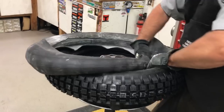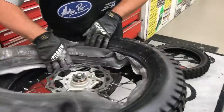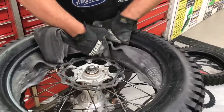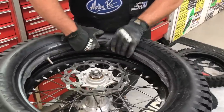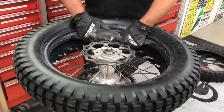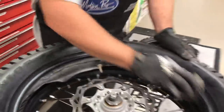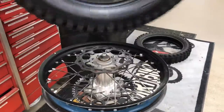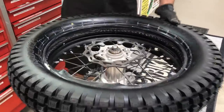At this point I'm going to just lift the tire and feed it in just like that. We are all the way in and I've got just the right amount of air in there. Now we're going to put tire paste on the tire — you want to have a good tire paste. Don't use WD-40 or anything like that because it stays too wet and can cause the tire to fall off. Good tire paste is a real good help — all the way around, and get the inside lip too, not just the side. If it's hot out and you're doing this outside, you might have to reapply after you get one side on because it will dry up.